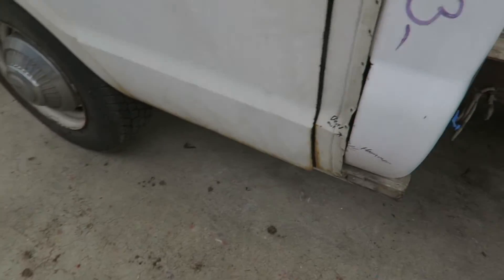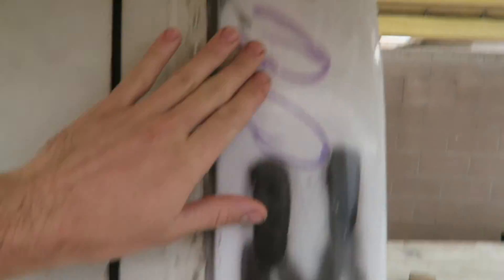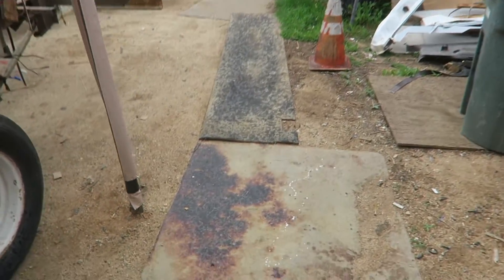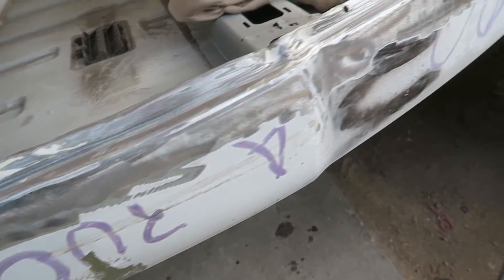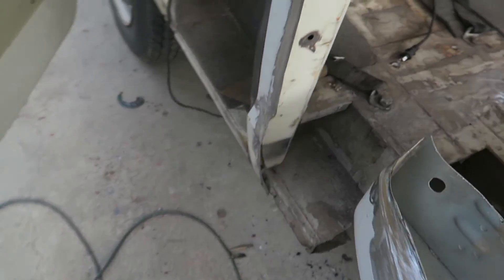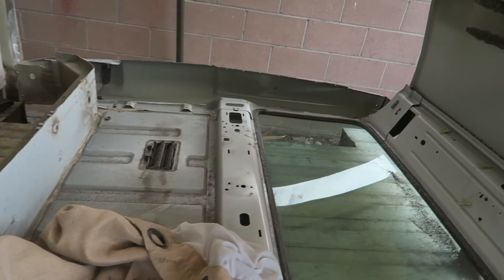California weather is so weird — it was nice five minutes ago and now it started raining out of nowhere, so annoying. I needed to grind today. About four or five hours later: I went around the whole perimeter of the cab and got it all down to raw metal, ground all the paint off with a 40-grit on my grinder. Same with this section. I also cut out all the extra sheet metal inside. All the extra stuff is cut off and everything is ground down.